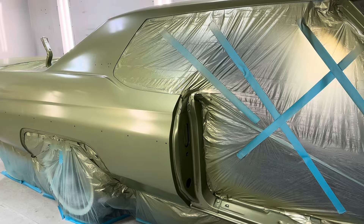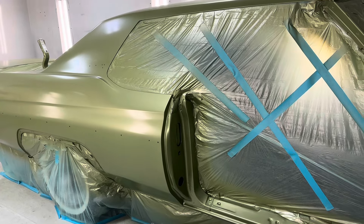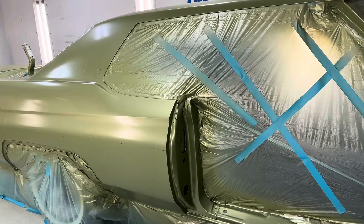I'm still making the base medium wet, but it's going to more or less just be wafted on the car so it's super even — this is why they call it a control coat. We're trying to control the metallics, the pearls, the things that are in the base, and just make the layout really nice and silky.